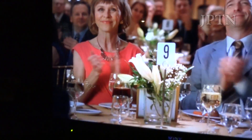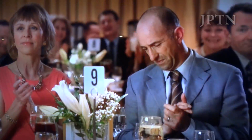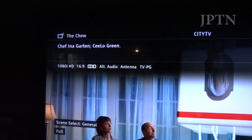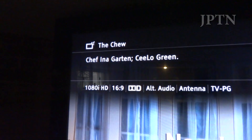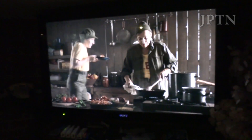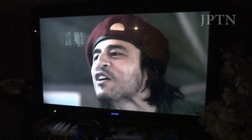Just for reference — you can get full surround sound using the Audio Return Channel. Right now I'm playing something off the air over the antenna, and in Canada, the US, and other places with over-the-air TV it is in 1080i HD with surround sound. So despite many people saying you have to plug the Chromecast directly into a receiver, you should be able to plug it into an HDMI port on the TV and have it return the audio. More testing and troubleshooting needed, but hopefully I can figure out why the Chromecast won't output 5.1 from Netflix.